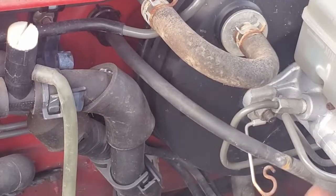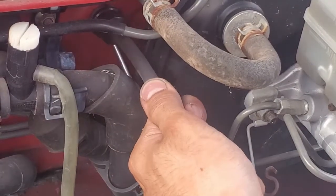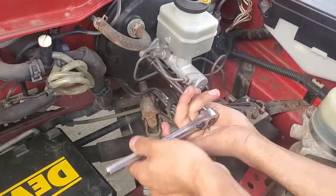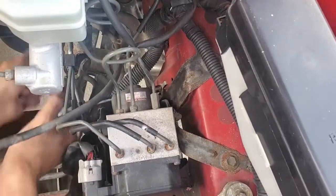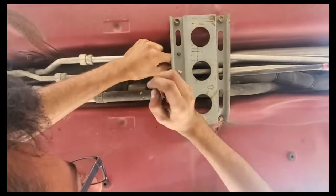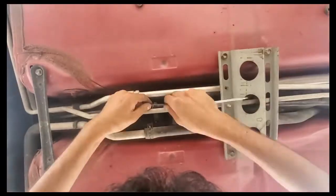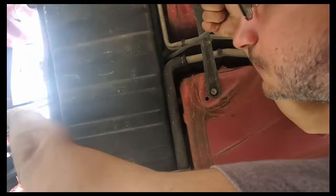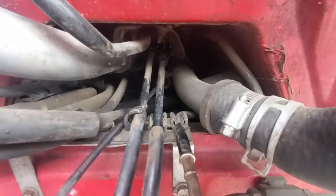You don't have to remove the entire cable, but I'm removing a few bolts to access the pedal cable sleeve from the front trunk. You can pry it out from the firewall and follow it from under the car. Then simply un-route it until you reach the back of the car. At that point, it's a bit tricky, but try to wiggle it from the engine bay and pull it out from underneath the chassis.